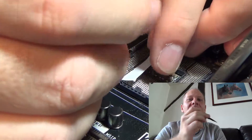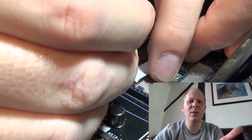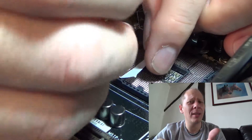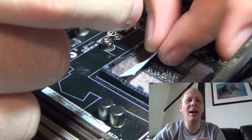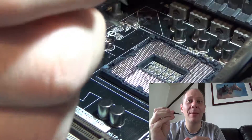Now you can use your needle-nose tweezers to straighten any stubborn pins that remain after using the paper technique — that's usually the case. Don't push too hard with the paper because you could make things worse, and be conscious of the pins behind the paper as well. Use your needle-nose tweezers to straighten up any of the stubborn pins that won't straighten with the paper.